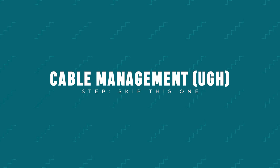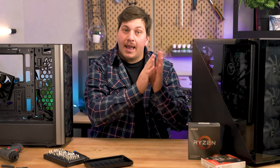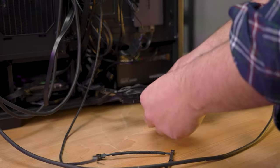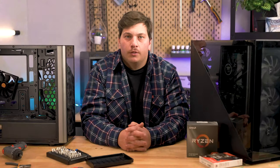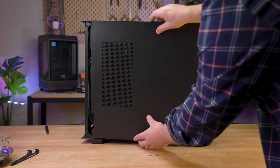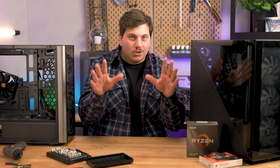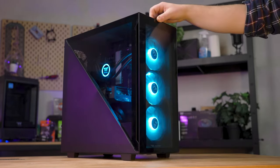Step ten, which is optional: cable management. Cable management is not everyone's area of expertise, but spending a bit of time tidying up the cables at the back can save you a world of hurt later — even if it's just grabbing some cable ties and bundling random cables together. It's honestly something you get better at with time, so give it your best and make it as neat as possible, but don't lose sleep over it. The tried-and-true method of cabling everything back into the case and sealing it with the back panel is still a solid option. Speaking of which, sliding that back panel on is the last thing you need to do. Seal it all up and congratulations — you've just moved your PC into a new case and given your setup a fresh new look.